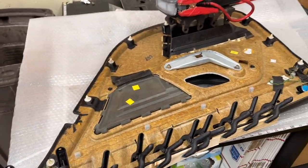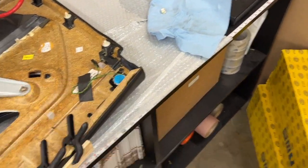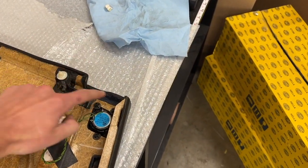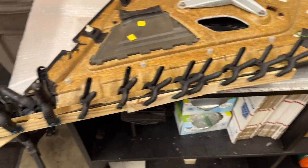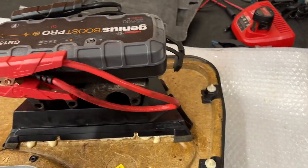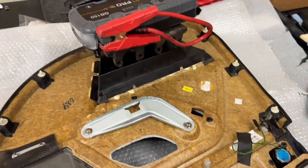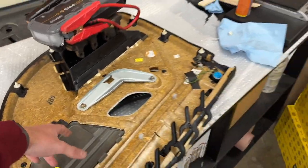Anything that was glued had let go. I removed that upper panel above the wood trim all the way back to the speaker grill. To take it off completely you've got to destroy those one-time use clips, which I believe are no longer available. So we left it there and hinged it open. All of that is going to re-glue overnight. The map pockets are falling off as well, so we've got those gluing up with rear brake calipers as weight. Once we replace a few busted door panel clips we'll have a fully restored, ready-to-reinstall door panel.